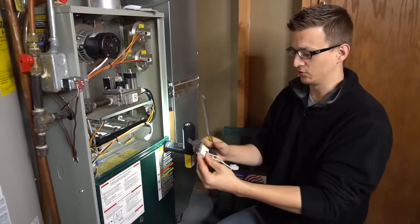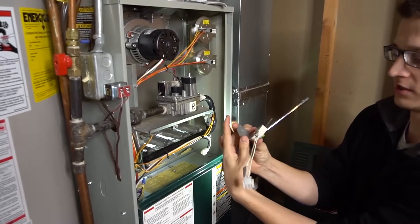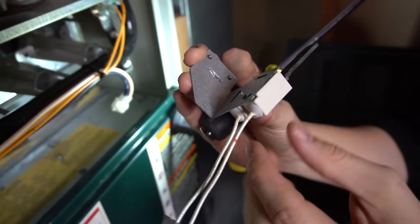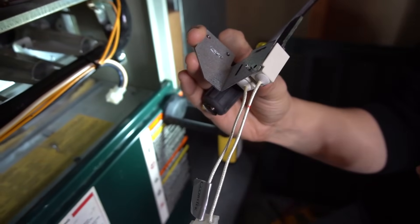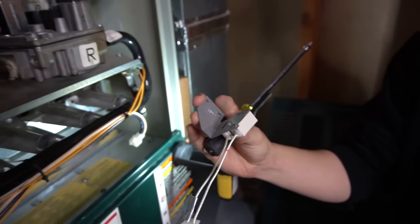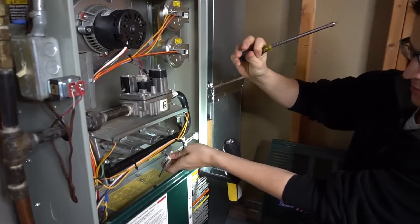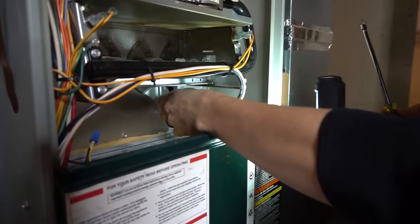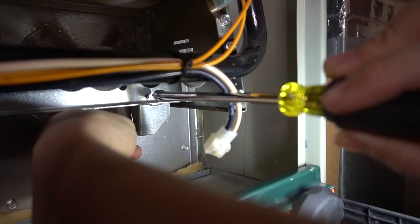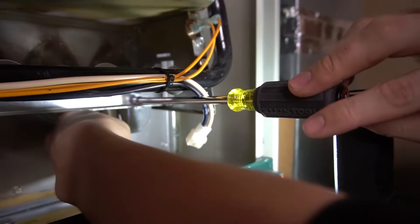There's really not much to it. Just make sure you get the right igniter. One more tip: sometimes there's a ridge on the igniter that won't quite line up — the new igniter may be a little longer. In that case, you can just take some pliers and break that little ceramic part off to make it shorter so it fits into the bracket; the ceramic is pretty brittle. Also, pay attention to how you took the old one out so you remember how to put the new one in — sometimes the bracket needs to slide into a slot. If the igniter is not positioned right, there's a good chance it won't ignite the gas.